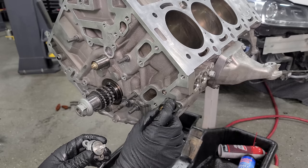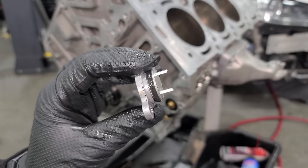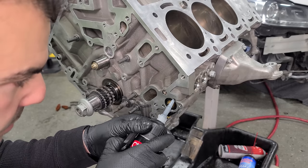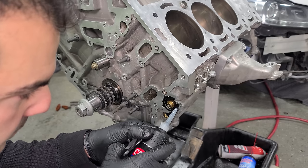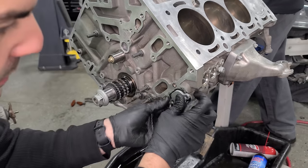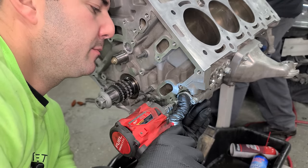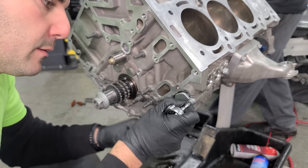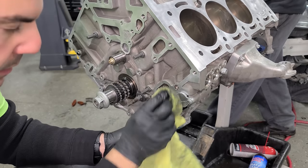I've got the engine turned around. Here goes our oil thermostat back in, and there's an O-ring here to replace as well. We need a little bit of RTV right here, then we can reinstall our plate. While you're holding this, you can tighten up your two T30s with a nice little hand tighten. We'll wipe away any excess RTV as well. That's resealed.